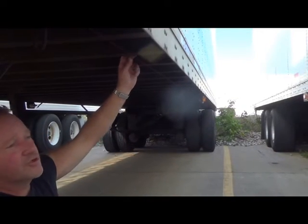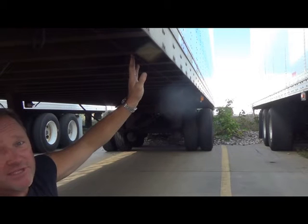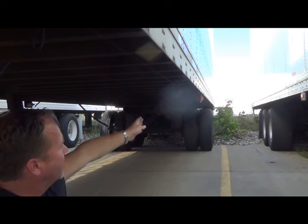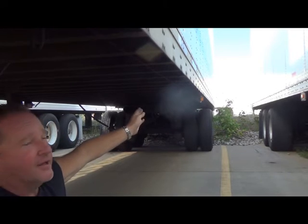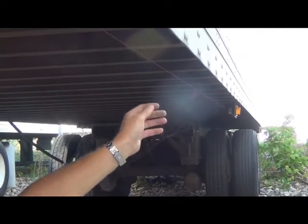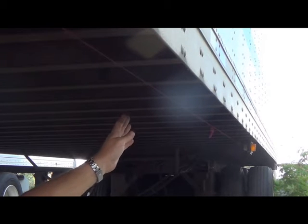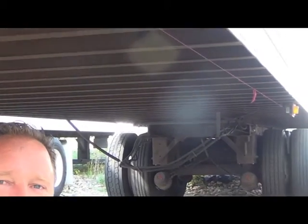Another way that you can install this trailer, which is slightly more efficient from an aerodynamic standpoint, is to set every stanchion 3.5 inches inboard of the outside of the trailer and run down the line. This allows you to still clear the turning light, and then the very last stanchion you put on the outboard edge of the trailer, creating a little bit of a kicker, so to speak, to divert the air cleanly around the tandems. By doing so though, once you establish the first set of stanchions, the last four, you'll have to start turning to come inboard to catch up on the inside of the landing gear gusset. It's on the diagram included in your instruction page.